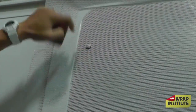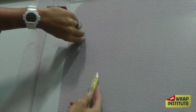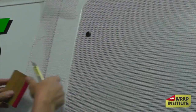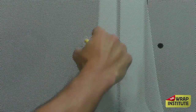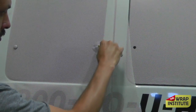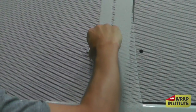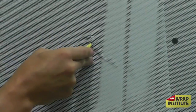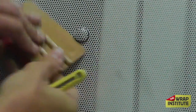For these kind of plastic fasteners, I generally remove the excess window perforation on top, because window perforation doesn't like to be on curved surfaces and this is a low surface energy area. So it's best to remove that. On the right-hand side, instead of trapping completely around the fastener, make that relief cut right away. Don't try to force the material onto the window — make your relief cut and it will simply fall onto the window with no tension. See how it just glides right in with no tension, using the hard part of the squeegee to tuck it in nice and clean.